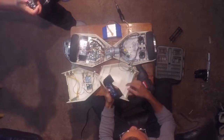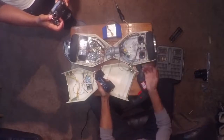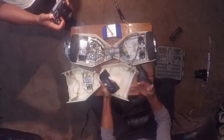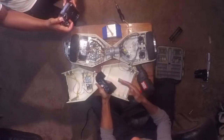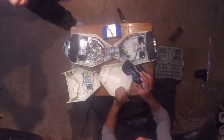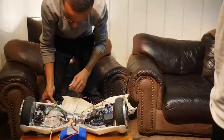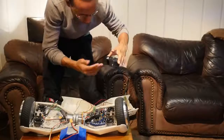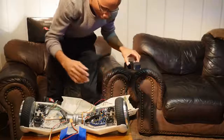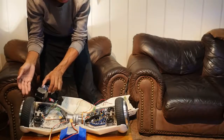Sometimes these things activate while you just turn it on. What the manufacturer will tell you to do is snip this because it's so tall that it's activating when it's not being pressed on. So if you get one and it's just always on, that may be the issue. It could also be a bad activation pedal sensor. To replace one of these, basically take off the other side — same deal, four screws, same connectors. These are pretty interchangeable, so if you had one side acting up you could swap it. If the other side starts acting up and the side that was messing up starts working, you can tell that was the problem.